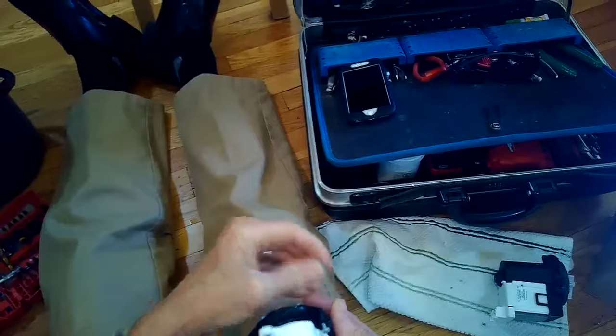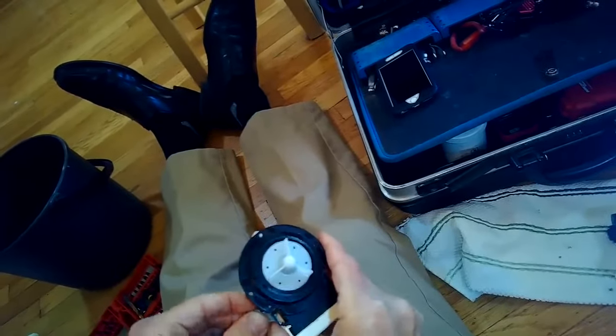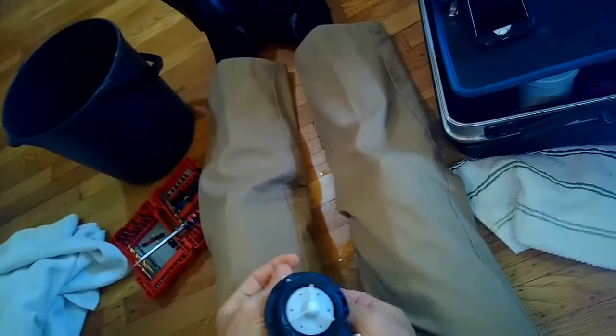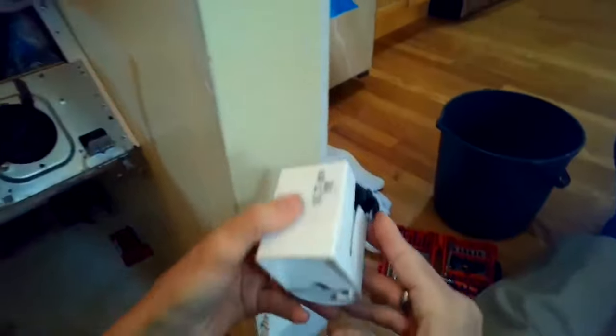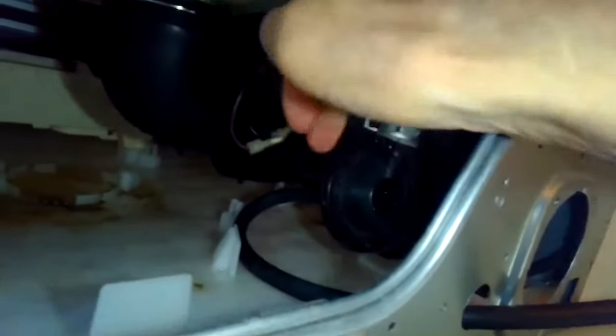You're going to get the 3 screws in position. So one at the bottom at 6 o'clock, and then one at about 2 o'clock, and one at about 10 o'clock. Those are the ones that are holding the pump tightly onto the housing, so it's a watertight fit. There's a little rubber seal there too that helps to create a watertight fit. So now we're just going to reach in and make sure that there's no debris there in the housing.